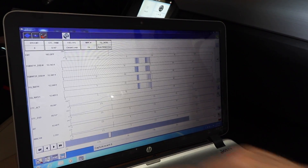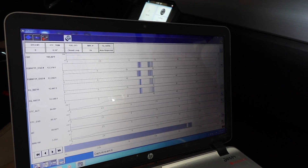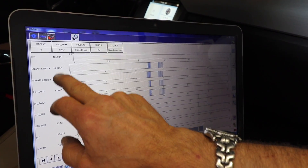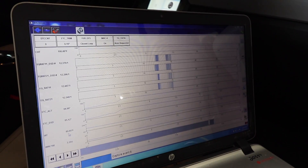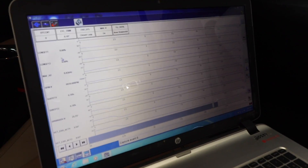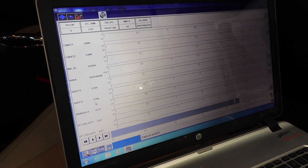Everywhere in between, it's doing exactly what it's supposed to do. I'm asking for a 12.3 air/fuel ratio and it's getting 12.3 to 12.4 — right in line. That's the air/fuel ratio. This is the intake air temperature, the degrees of throttle body — actual vs. desired. Then there are your fuel trims showing how much fuel has been added or subtracted. At wide open throttle, we're less than 1% fuel trim, which means the mass air transfer function I developed is perfect.